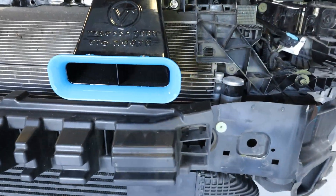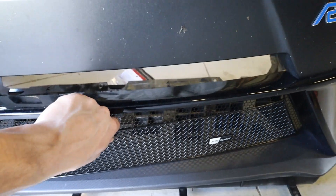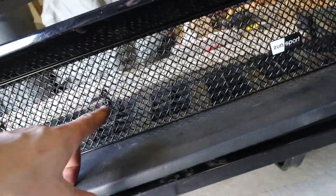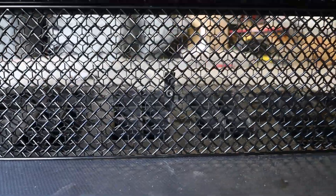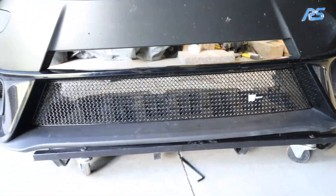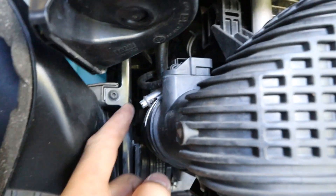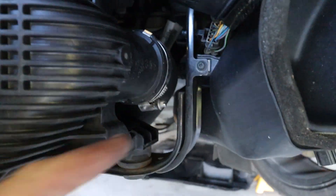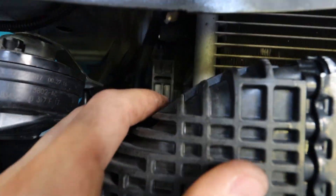I got the big mouth installed in the nitrous blue. Next up, I'm going to install this bottom grill piece right down here. There we go — just three little tabs here, here, and there. I oriented mine going straight up and down. I think it looks a little bit better than sideways. Still kind of hard to see, but that should reinforce it a ton. Now under the intercooler, there's a clamp right here and a MAP sensor on top of the intercooler itself. And then on the other side, same thing — take that off. And then we should be able to just pull this intercooler right off and slide it out of these little mounts.